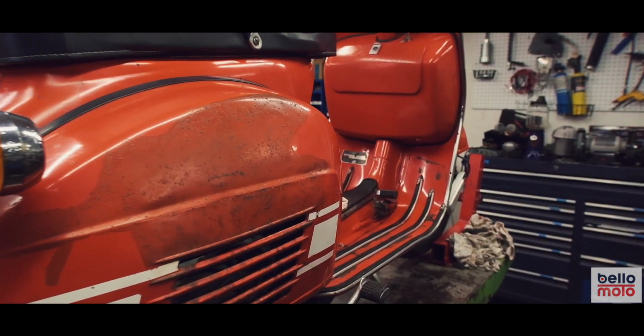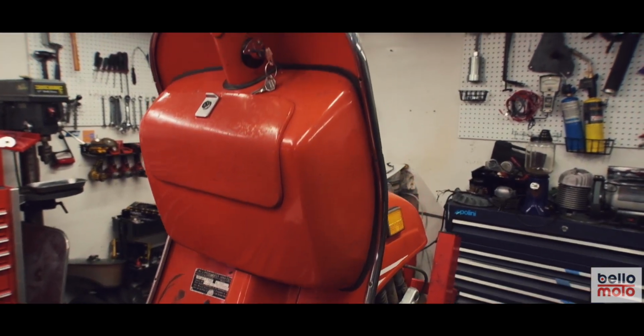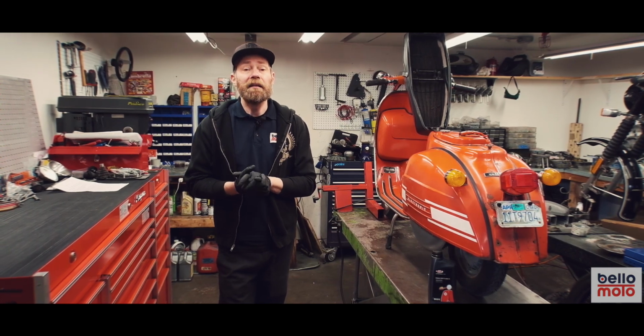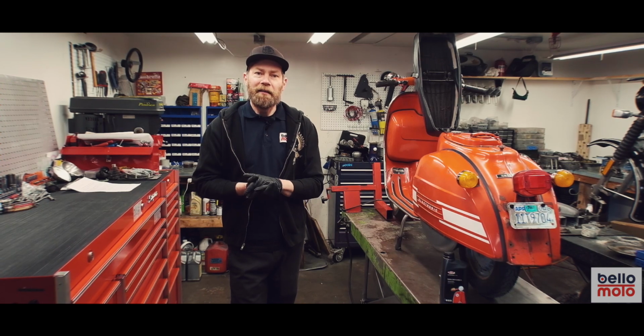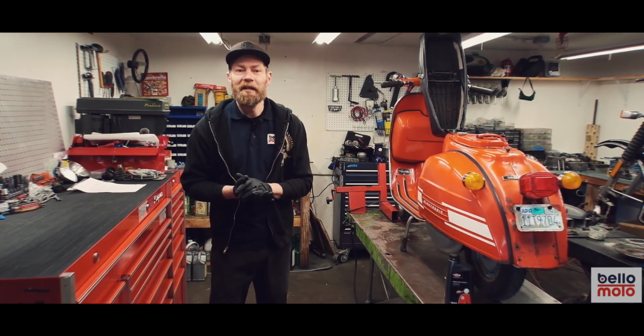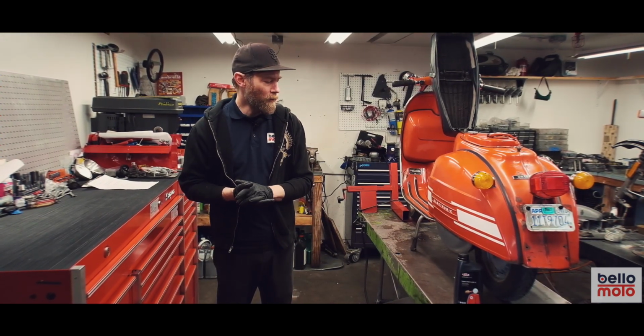And the older ones, like the Faro Bassos and the very earliest Vespas from the 40s, actually had a 6% ratio. So that was north of 7 ounces per gallon you needed to add, and a lot smokier. You can imagine back in the day on the streets of Rome or something, how much smokier those scooters would have been. Today, with modern synthetic oils, things are way more clean burning.